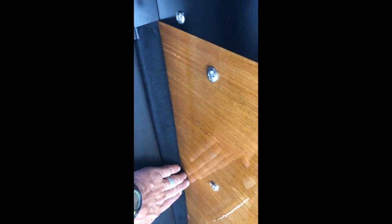It's kind of non-standard — you can do better, especially if your panels aren't cracked and you can just cut them an inch and a half longer. There's a speaker just past this point, so when cutting the panel you'll be close to that speaker hole. Work out your insulation plan first, because that drives where your cut goes — that's why I'm hesitant to give anyone exact dimensions. The B pillar cover goes in the factory way with plastic clips in the back and clips into your door seal.